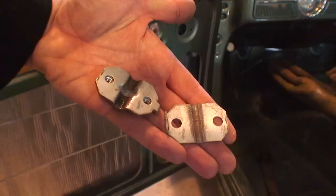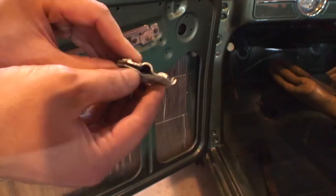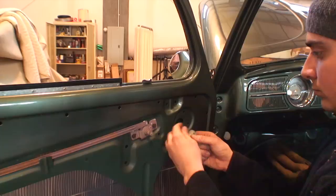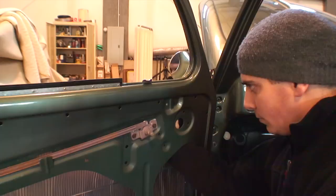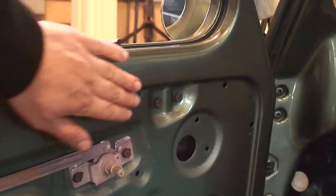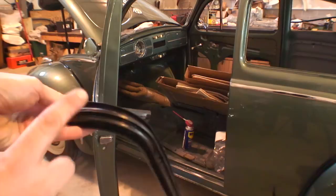Now here's the vent window section. There's a metal piece here that goes in behind — there are two pieces and they fold together. There's a certain way they go together. You hook it in just like that, and that goes on the inside of the door up into that section there. We're going to put everything in loosely for now — you're not going to bolt anything down tight, everything goes in loose. These take the 10 millimeter headed bolts that are 6 millimeter threads — usually pretty short and stubby. As you see, I still have it very loose, because that makes it easier for you to get the vent window in.